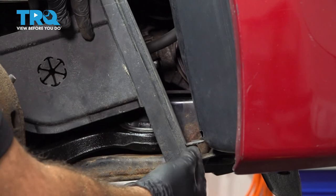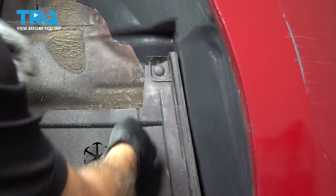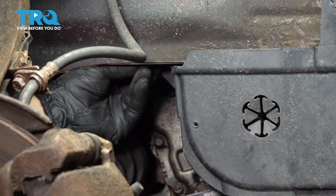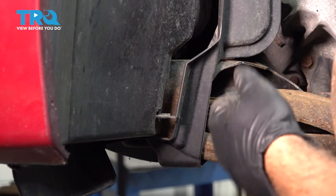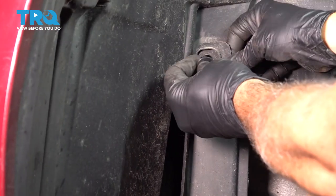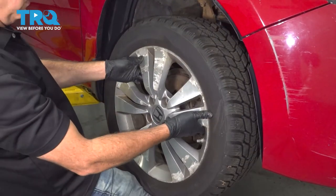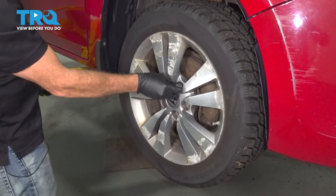Let's go ahead and install this piece right here. There's a little tab that fits into our fender liner. Put a button up on the top here, and right on the back side, this tucks underneath — there's another button that pops up underneath here. Press that into place. We'll go ahead and do the same for the driver's side. Install this little tab into the fender liner. On this side, you're just going to have one retainer. Go ahead and lock this in and push that into the body. Let's go ahead and install our wheel.